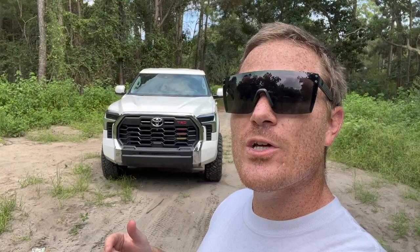All I have to do is pin back this liner a little bit more and I shouldn't have any issues. Whatever kit you go with, whether it's a full suspension system, get an alignment afterwards. I've had a lot of people DM me saying the Westcott kit rides like crap — did you get the truck aligned afterwards? Go to either your dealership if you trust them, or a good alignment shop that works with off-road vehicles and knows what they're doing.